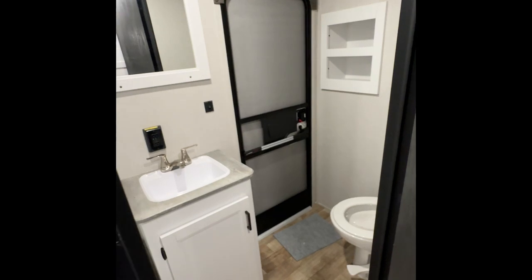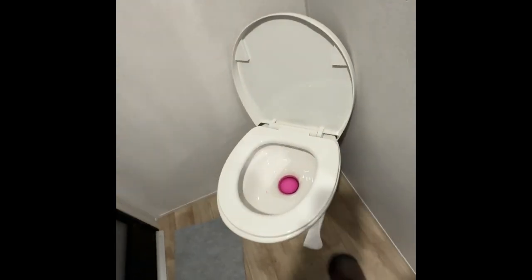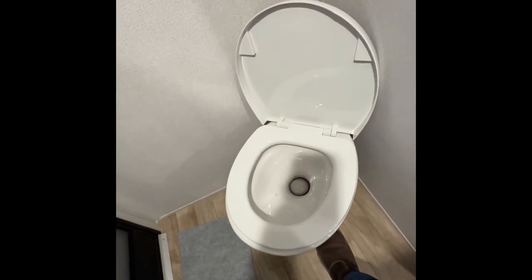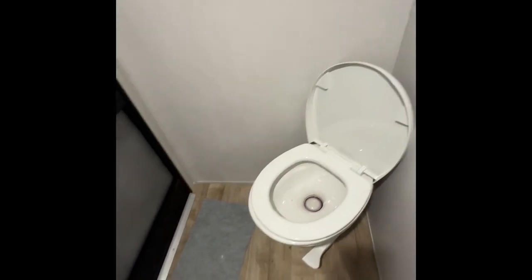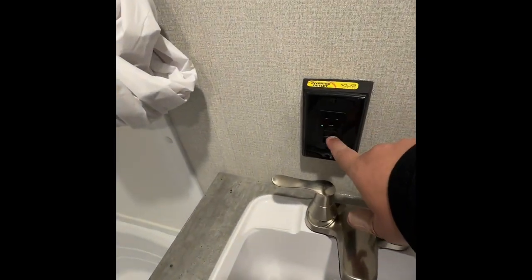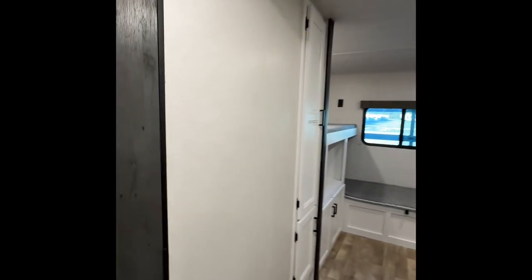As we come into the bathroom area, just a couple of things to note: to flush the commode, there's a foot flush — press down and if you push just a little bit it'll bring water into it. Now it's winterized right now with antifreeze through the whole system, so you'll want to run the antifreeze out of the lines before you use the water. One other thing to note: this is a GFI outlet, so if this outlet or some other outlets are not working, check that GFI — if it trips it might take a couple of outlets out with it.